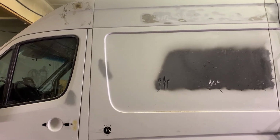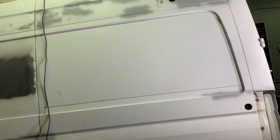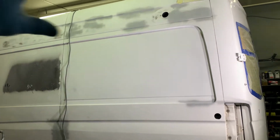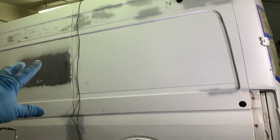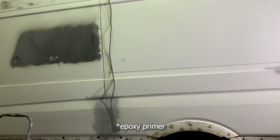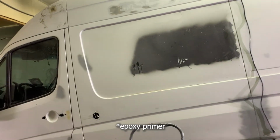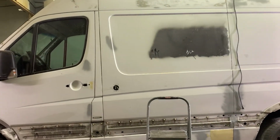So keep on working. Also, I ordered the base coat, same color, it's going to be a navy blue, dark navy blue. So we'll cover the entire van with a base coat first, and then we'll go with the rubber stuff. And I'm going to use the spray gun with the 1.8 millimeter nozzle to spray the rubber paint. And we'll see how it's going to be.